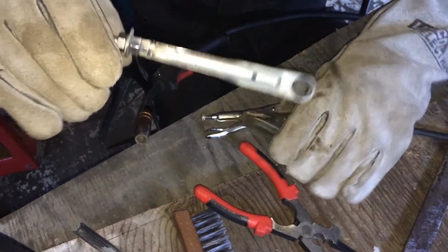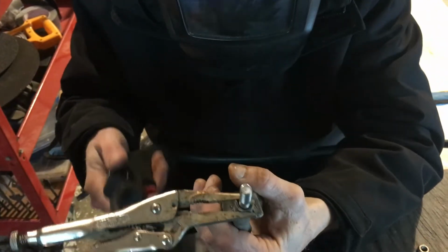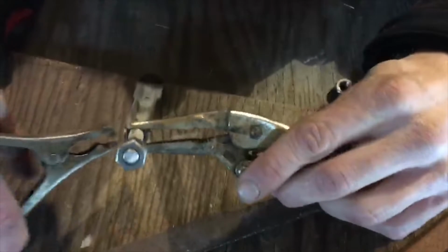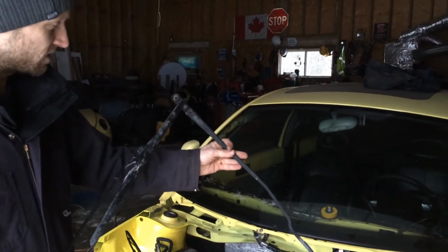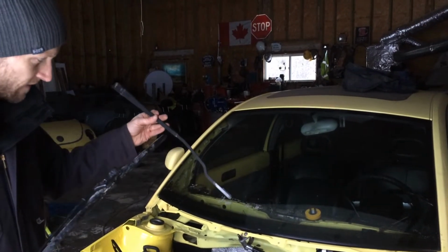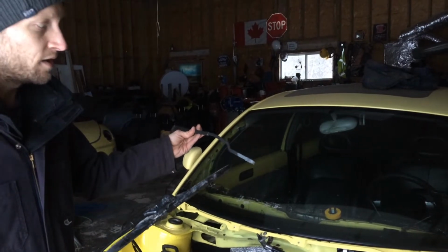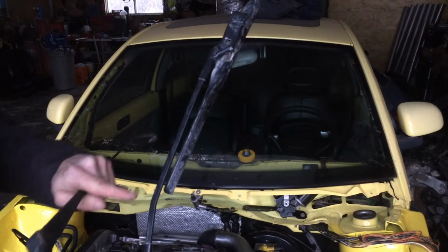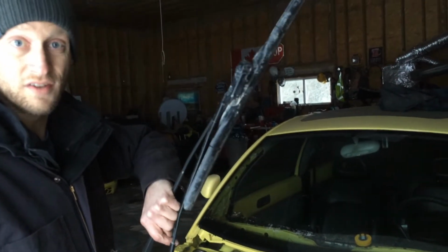It worked, but like slipped off, bounced all around, you know? Perfect. So what we've decided is we're going to take this arm, the base here, because it's nice and perfectly straight. Where it comes out and its first bend, we're going to cut in front of that. And here on our loop that hooks into the wiper blade, we're going to cut just before it bends down here. And then actually this straight segment out of this other wiper arm is going to be used, cut, and put in to join those two. So we'll weld all of those guys together and hopefully have a straighter wiper arm.